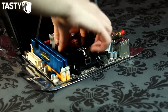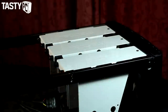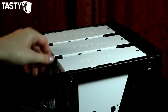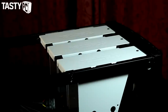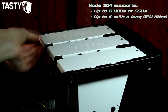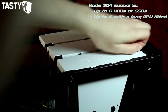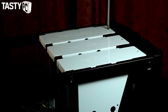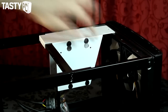The H60 comes with an SP120L 120mm fan but I'm not going to be using that fan in the build. I'm also not fitting any hard drives as my parents just need a single solid state drive to stream content over the network from my main rig. The case can support up to six hard drives or solid state drives — two per tray. Whether or not you have the hard drive tray closest to the front determines the maximum graphics card length you can fit. I'd recommend removing the hard drive trays while building as it makes the Node 304 easier to work in.